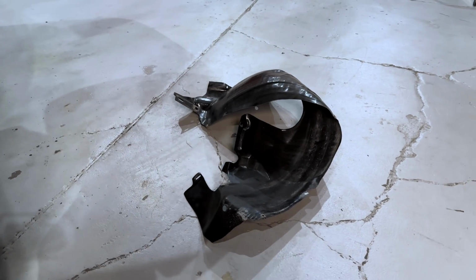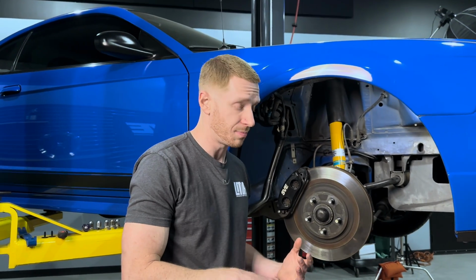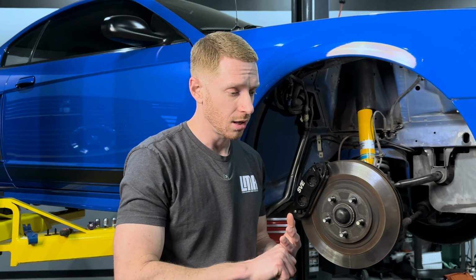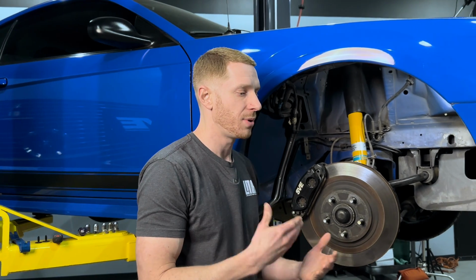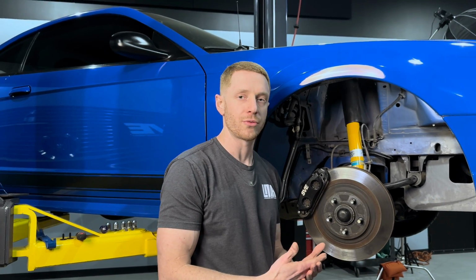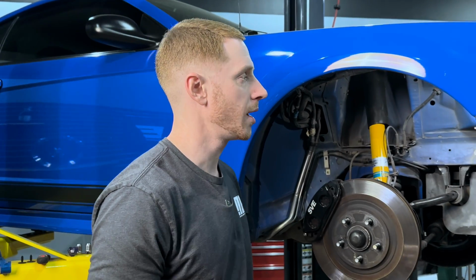So the reason why we're going to just talk real quick about the CCRM is because A, it contains the fuel pump relay, but B, it also contains the PCM power relay, the AC clutch relay, which is also commonly referred to as a wide open throttle cutoff relay. And basically what that means is whenever the PCM sees wide open throttle from the throttle position sensor, it shuts off the air conditioner or shuts off the air conditioner coil. It also has the relays for the high and low speed electric fan.